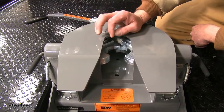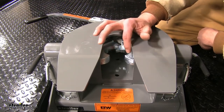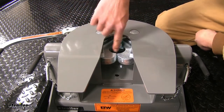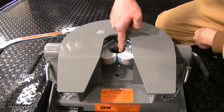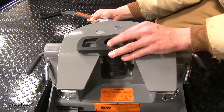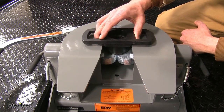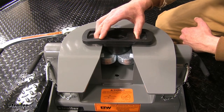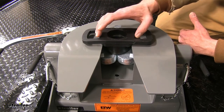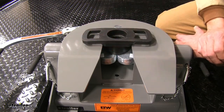The jaws are also very high quality — you can see they're one inch thick, and we have dual jaws with one coming in from each side. We've got a perfectly machined hole here to hold our kingpin. Putting our mock kingpin in, it's going to reduce any forward and back or left to right movement. That can lead to the chucking feeling we sometimes get when starting and stopping, and also leads to noise. With that nice snug fit, we're going to help eliminate both of those.